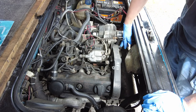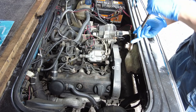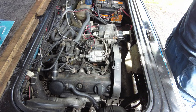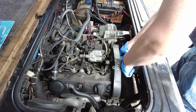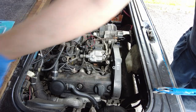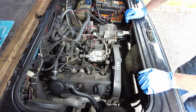The auxiliary belt is just a case of taking the tension off the tensioner — I'm going to use a pipe wrench for that. Another specialist tool I have is a socket actually welded into the spanner, just to make something quite shallow to go between the exhaust and the pulley to turn the engine over. It's useful on the Golf as well and any other Volkswagen TDI engines — it's actually a three-quarter socket. So I'm going to grab the tensioner pulley, bend it back and unhook the belt from the alternator. Changing a belt in one of these is a handy little job. I did have to put an overrun pulley on this alternator as well, although I'm not entirely sure it's working properly — we'll have a look at that at a later stage.